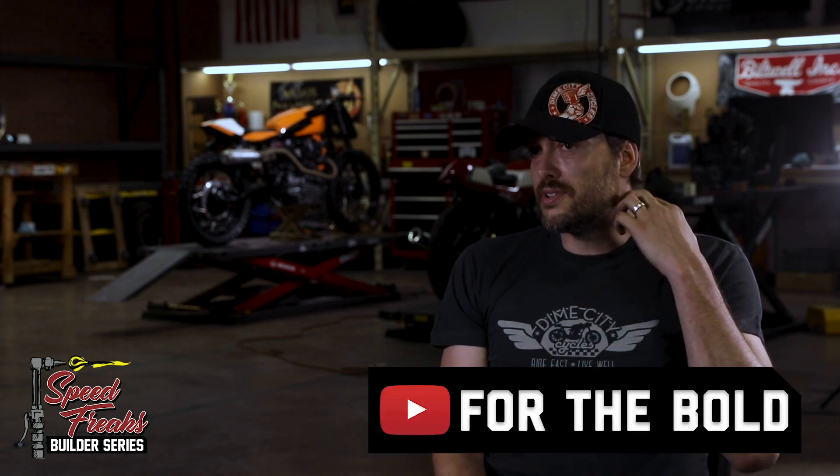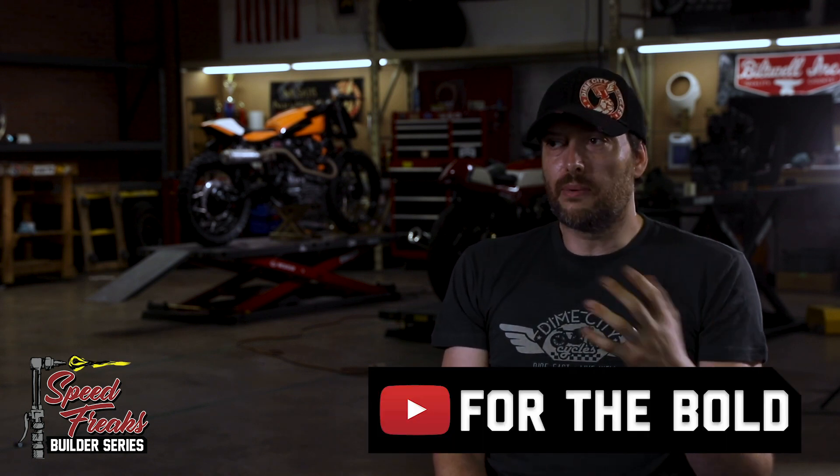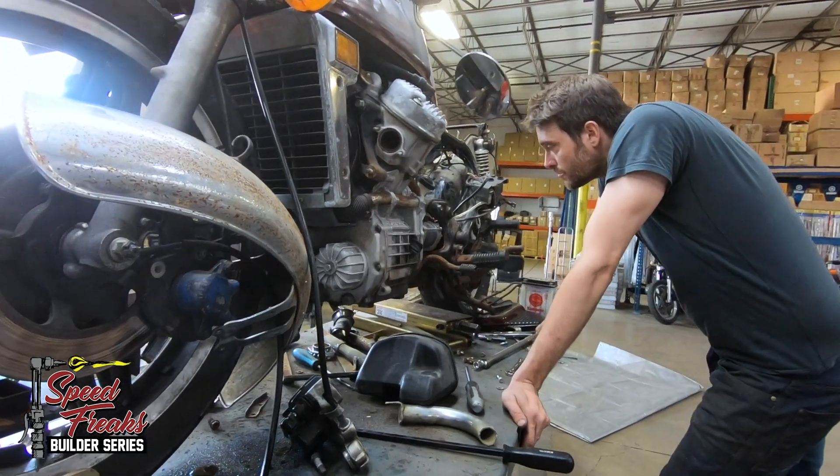The exhaust was a new challenge for me — I haven't done an exhaust before, but I wanted this bike to stand out. Being a tracker build, we would get called out by the YouTube community if we didn't put an exhaust going up through the top. Because obviously on a tracker, scrambler, or motocross bike, you don't want your exhausts going underneath — if you bash against any ground, you're going to dent and break your exhaust. So that's the whole point of them going up.